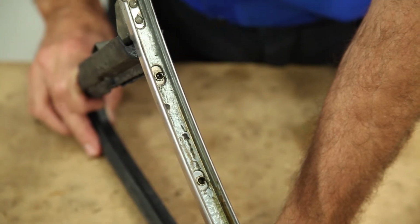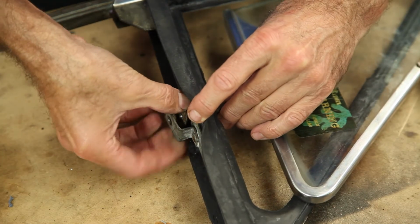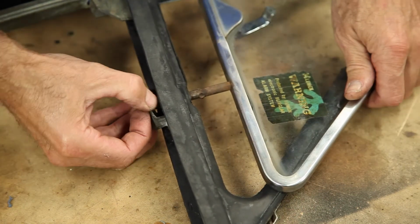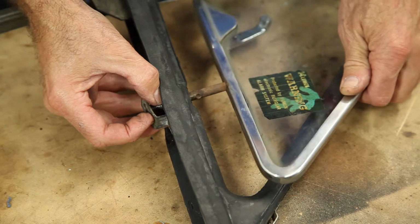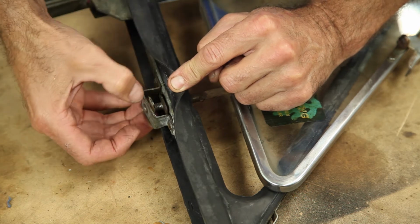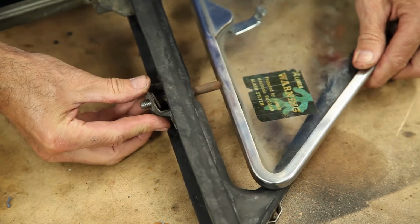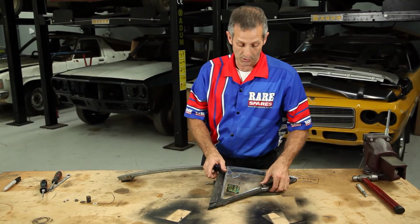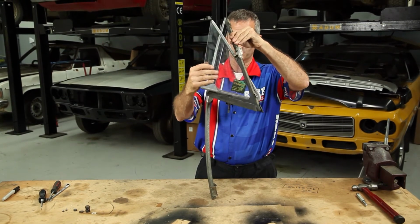So when it's time to put the quarter vent glass in the frame, grab the cam. Now they're usually a bit difficult to try and get into position. Again, don't be in a hurry. And you can push the glass quarter vent assembly forward. So once it's in that position, then you put the plastic washer over the pin, over the thread. So once you've actually got the washers in place with the plastic washer on the bottom, you can open the quarter vent and see if it's going to actually open. So the cam is around the right way.